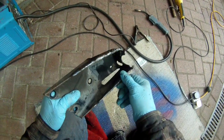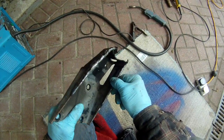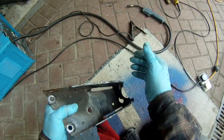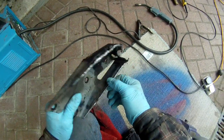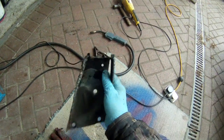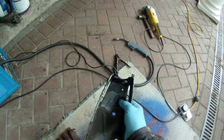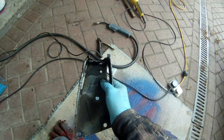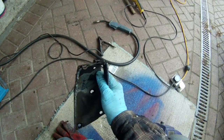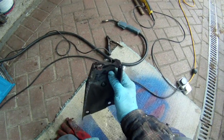I've used stainless steel to do the welding, just my personal preference, probably doesn't matter too much, but stainless is a stronger metal and so probably creates a stronger support system for supporting the clutch slave cylinder. And having done that before on a Freelander clutch that had a bite point very low to the floor, it drastically improved it and basically brought it back into operating like a proper clutch with a bite point on its halfway travel point. I've caught this one just in time.